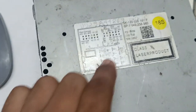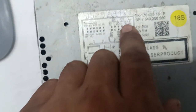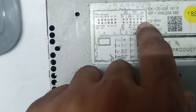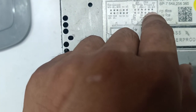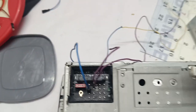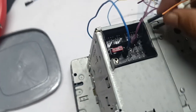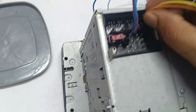If you need to give an input from your mobile via AUX connector, you can connect here. You can see: AUX in right, AUX in left, and AUX in ground — these three connections. If you provide these three connections it will work like an audio jack. You can get this type of connector from the market and connect aux in, RX1, RX2 like this.